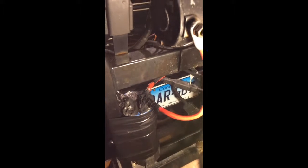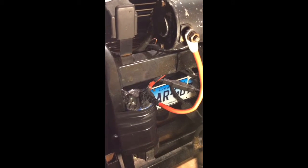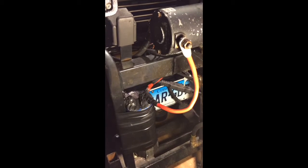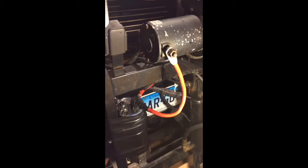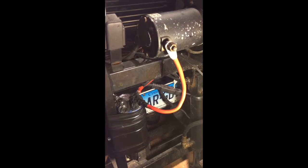It really makes the voltage on the gauge in your vehicle not drop down so much — it's actually dropping much slower. Initially when I hit the plow up mode, it would really hit that gauge and take it down to 9 volts. Now it has its own little cell that it can draw from, and it basically improves the response of the plow and doesn't hit that battery or alternator as hard when you actuate the plow.